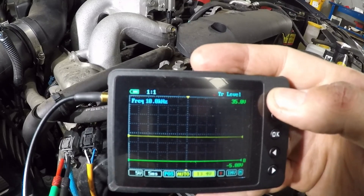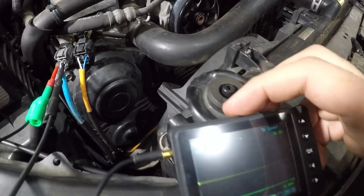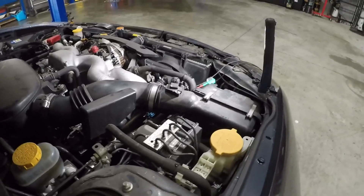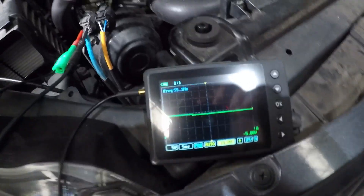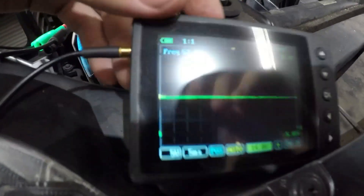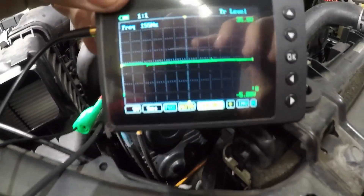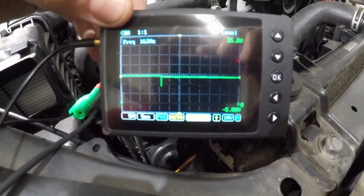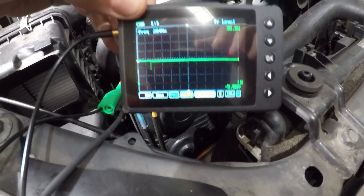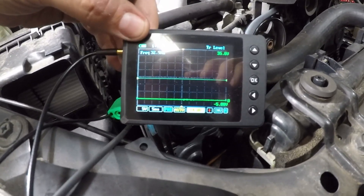Let's start the car up and see what happens. As you can see, battery voltage straight to the heater resistor circuit. But after a small amount of time it drops straight to ground, because the PCM realizes there is low current and stops deploying power to the heater circuit - and it just happened there.